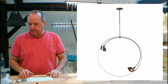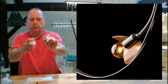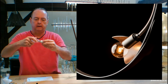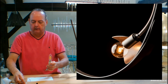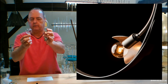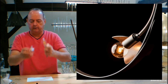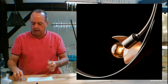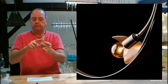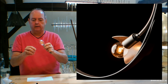Okay? So after that, why don't we talk about lamping and what's inside this. You're going to be using 2 of these Type B porcelain screw-in sockets, very small Type B bulbs, and you'll notice the picture of it on our site has it using these little G15s. You can also use these little torpedo things. You can use flame tips. As long as it has the smaller top on it, you're good to go, or smaller bottom on it, I guess. You can get these all in LEDs too. As a matter of fact, this is an LED. You can find these, believe it or not, all the way up to 100 watt equivalent. You have to do a little work online, but they do exist.